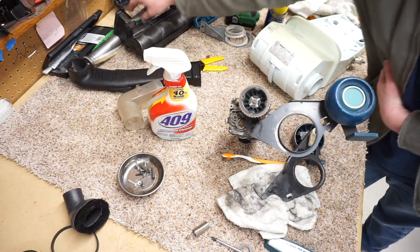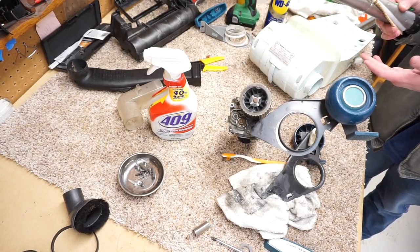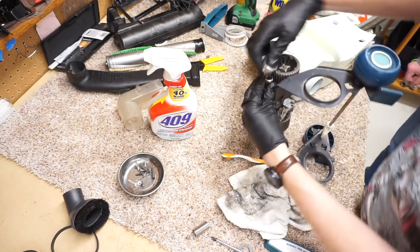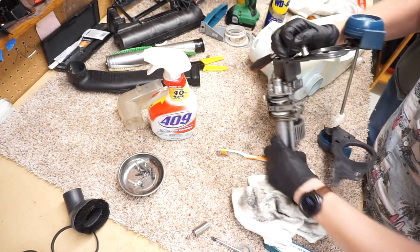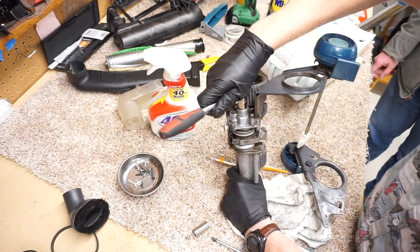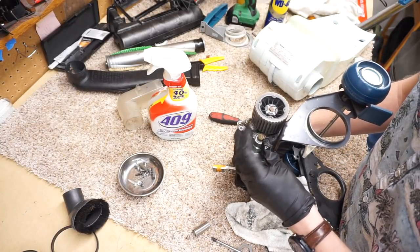Whereas, by the time we had plastic carpet, we realized that doing away with the beater bars and going with stiffer bristles offered better results in the grooming and overall cleaning. Yeah. That's why the change in brush roll design and the elimination of beater bars. Carpet construction, carpet materials changed. And the vacuums had to as well. Yeah, the vacuums changed with it. Because, you know, the point of the vacuum is to clean the carpet. So as the carpet changes, it only makes sense that the vacuum cleaner must change with it.